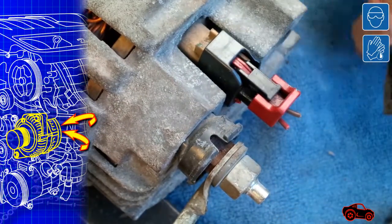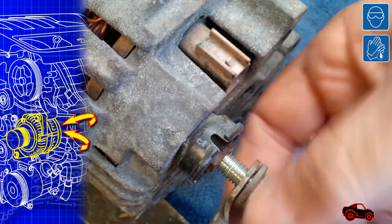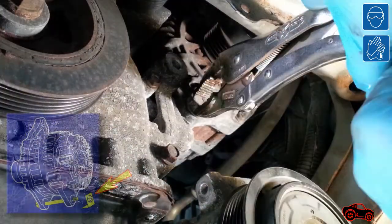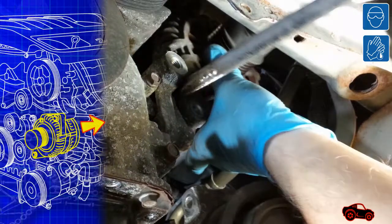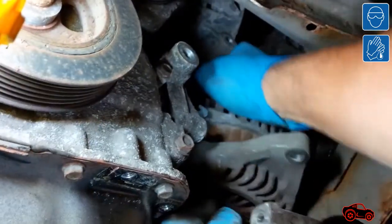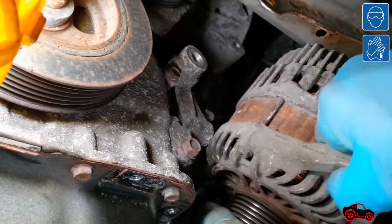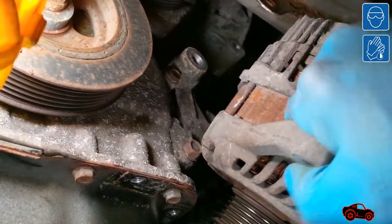Before removing the alternator, the eyelet connector and the locking connector had to be disconnected. It was difficult to film so I made a separate video clip to show how to do it. To remove the alternator, I began by undoing the upper retaining bolt. The pivot bolt was well located and easy to undo. At the end, when there was no resistance while rotating the bolt, it meant the pivot nut was not holding on anymore — I simply had to pull out the bolt. Since the pivot bracket was still tightly compressed, I had to use a small pry bar to loosen it and get the alternator free. Following the company procedure, the alternator was rotated 90 degrees with the pulley facing down and the upper bracket facing outboard. There was not enough room and the alternator was touching and scraping against the engine block, the frame, the AC lines and the AC compressor during the removal.